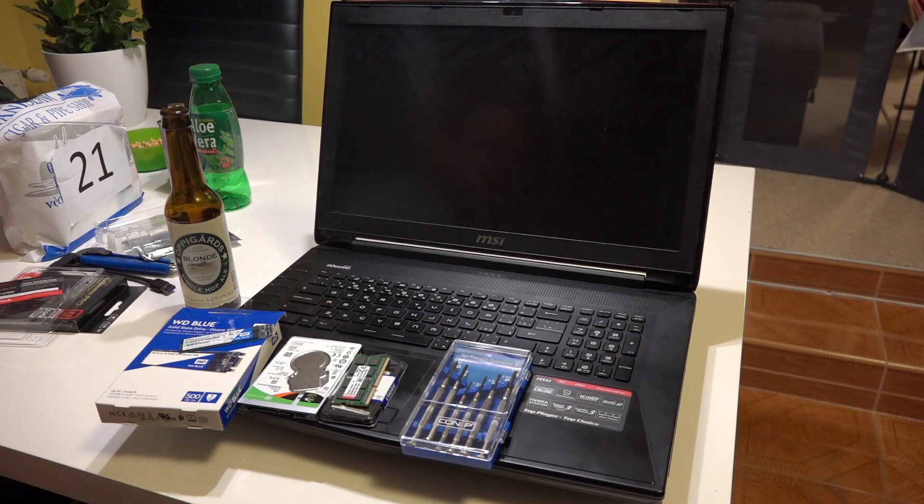Let's get into it. Basically, what you need if you want to upgrade RAM: get more DDR3 RAM. The original RAM in this notebook runs at 1600 MHz. For the hard drive, you can upgrade from one terabyte to a two terabyte hard drive. You should stick to a 7 millimeter hard drive.